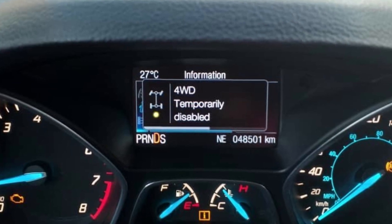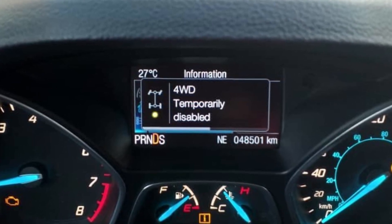The four-wheel drive temporarily disabled warning in your Ford Escape was initially made to inform you about problems with the all-wheel drive overheating. So if the differential overheats, you will get this message and the all-wheel drive will be disabled for some time. It was meant to inform you that you should drive more carefully off-road, because there is slippage in the differential or transmission due to the load. Ford engineers made this method to protect the all-wheel drive systems.